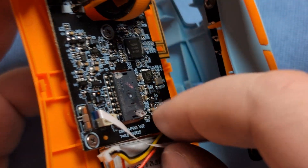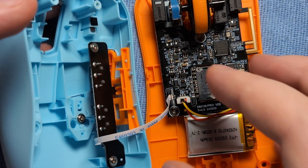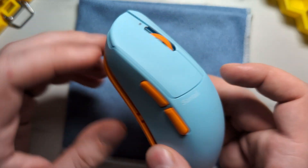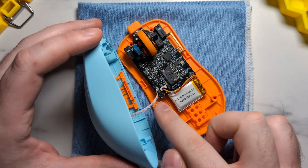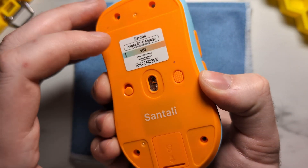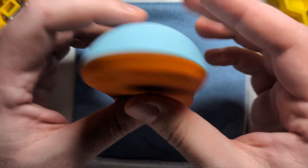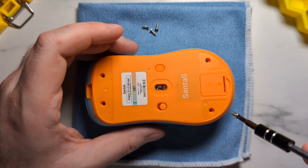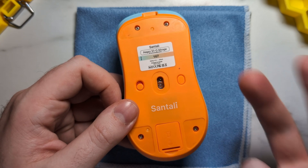Clip the connector down to anchor the side buttons. Then reconnect the battery by putting the connector back in. Before putting the unit fully back together, roughly put the shells together, flip the unit on, and verify that everything works — test your main clicks, side clicks, center button, and scroll wheel. If your side buttons don't work, it's most likely because the cable isn't in all the way — just disconnect, push it in a little more, and it should work. Once everything is verified functional, turn the unit off, then put the shells back together. They naturally sandwich together — put a little pressure on the bottom and they will click into place. Push down on the sides for any gaps, re-anchor the base screws, and run your finger along the sides to verify all clips are connected.